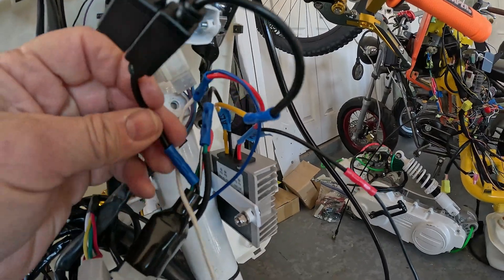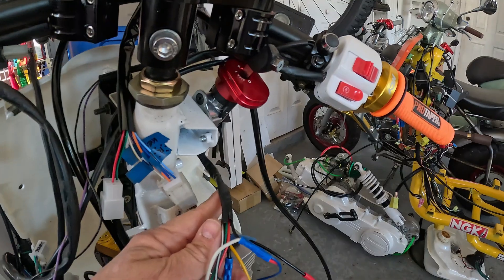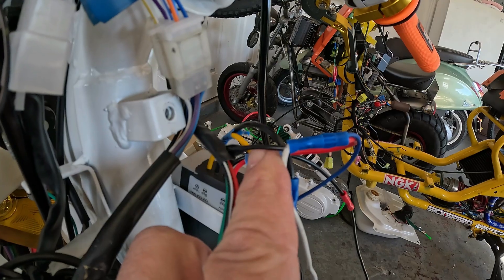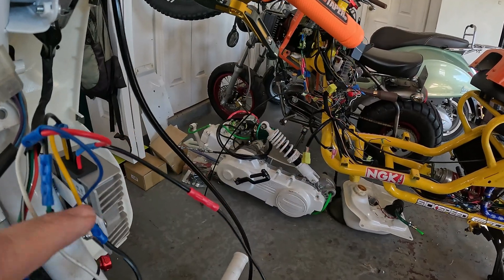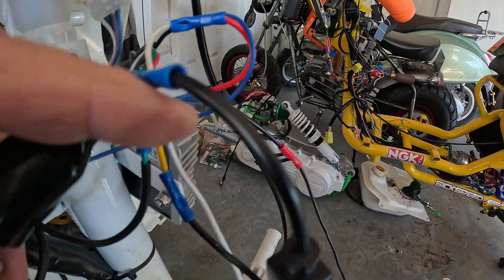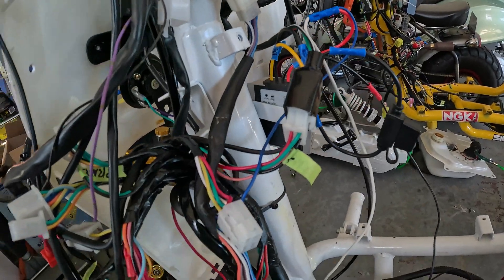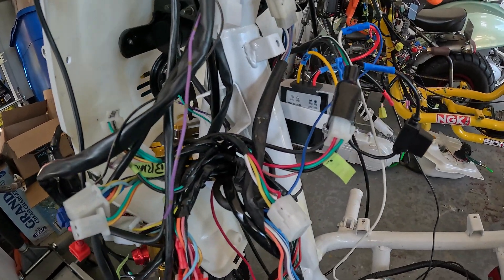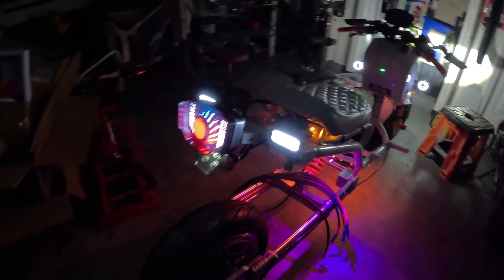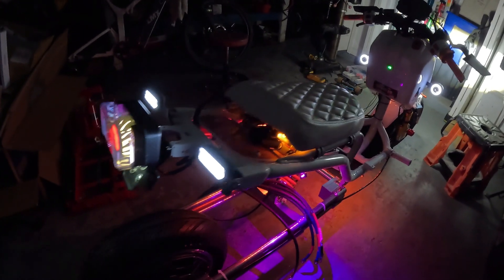The DC converter will take your negative and bring it through. We put it on that little negative wire that was on the battery — the small one — and that's going to give a negative to everything on the bike. Then we put the 12-volt positive coming out on the positive side. I put a fuse on there — figured why not. I feed that 12-volt positive right back into the black wire. I've only cut the wires coming out of this key switch — I can replace that key switch, no big deal. So it comes out of the key switch at 72 or 96 volts, goes through the converter, then comes back into the key switch at 12 volts. From the key switch, it goes into the wiring harness at 12 volts — powering all the lights, blinkers, horn, everything.